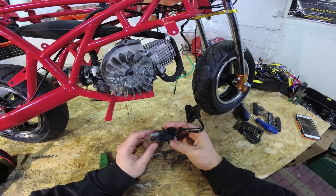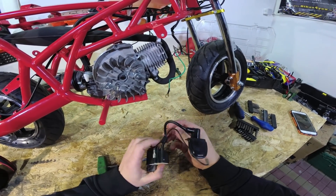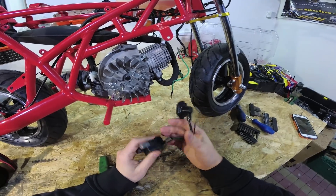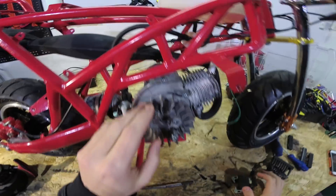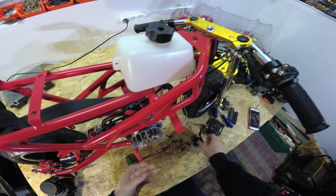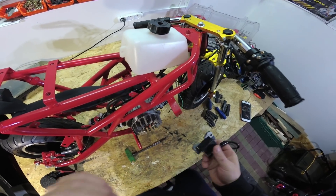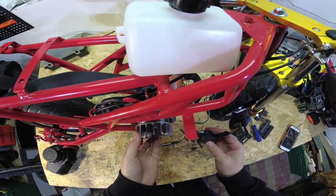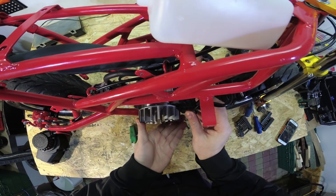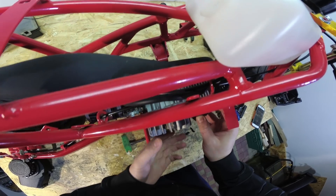Here is the coil. As I said, you may find the coil faulty - you can just replace it, it's only a few dollars. So we have removed the coil and I will show you how to properly install the new coil. When you receive the new coil you place it in the same position, but you need to be sure to leave the proper space between the coil and the flywheel.